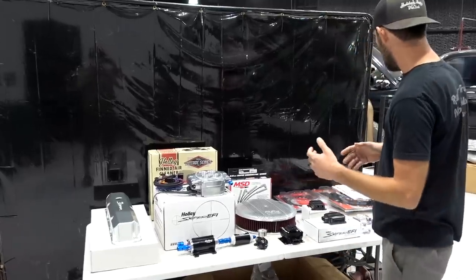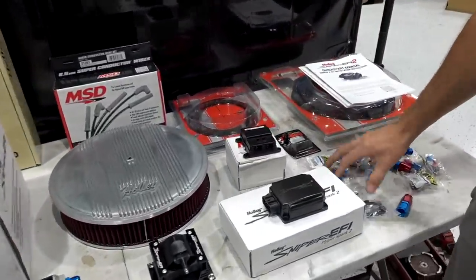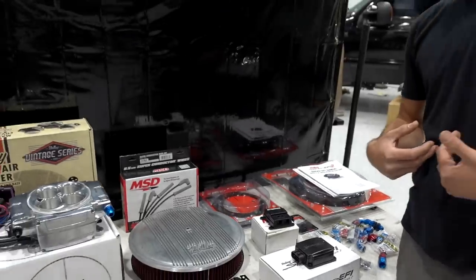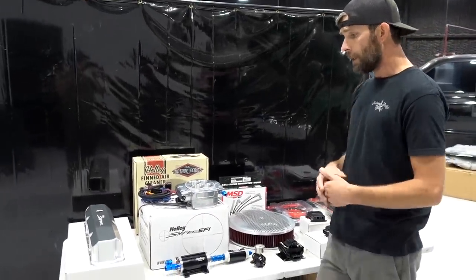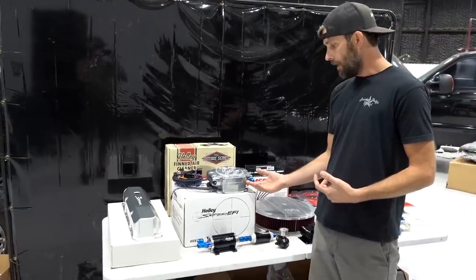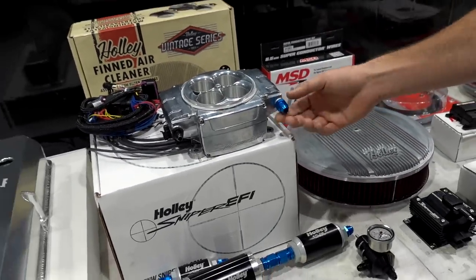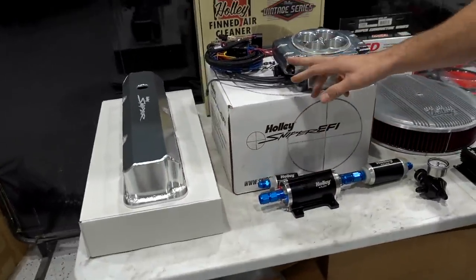So we've also got some mystery gasket fuel line. Looks like we might need a little bit more. You're going to need a plethora of AN fittings. It always seems like no matter how many you order, you need more. So in our opinion, the best thing to do is to get all your basic stuff unboxed like we did. And we ended up overnighting some more fittings so that we could start on this video today. Like, we went to a Dash 8. This is, I want to say, 9/16-18 straight thread O-ring to a Dash 8 because we're running all Dash 8 supply. We're running Dash 6 return.